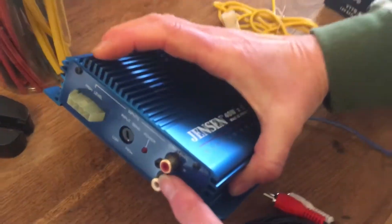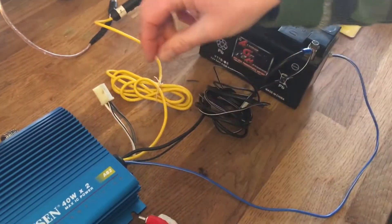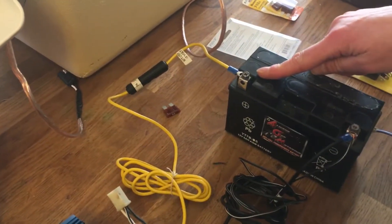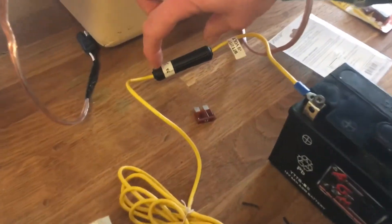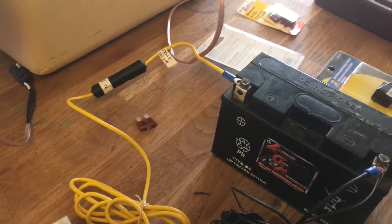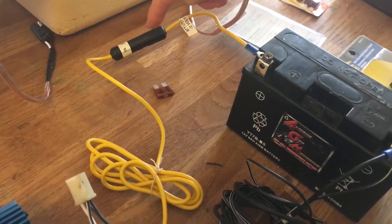On the amp, on one side you have the inputs for the RCA cable, and on the other side there are all these wires coming out. First, we have a positive lead — this one happens to be yellow — and this positive lead attaches to the positive terminal on the battery. You should install a fuse. This particular one is a glass fuse, but in my unit I've got a blade fuse. The blade fuse is easier because they're found everywhere — if you blow the fuse in the field you can go to a gas station and pick one up. These glass fuses are a little bit harder to find.